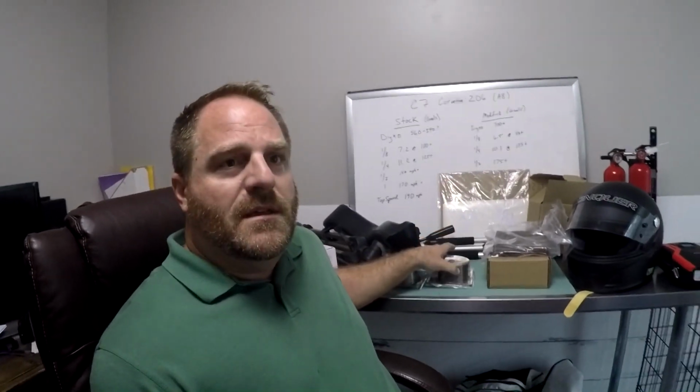And then I also bought some tape. The tape portion of it is to go around the A8 transmission. It is towards the back of the car, and the exhaust pipes run right next to it on both sides. What I want to do is the heat shield tape on both sides of those as well. This doesn't protect the driver at all. There's still heat that comes into the cabin, and I'm fine with that. It doesn't bother me at all. But I do want the components to be protected, so I'm going to try to protect the engine with the heat shields, and then also do heat shields around the A8 transmission. So I'm hoping, even with just those two things, that'll help quite a bit.